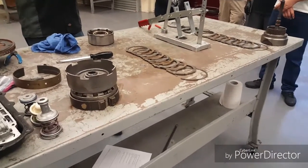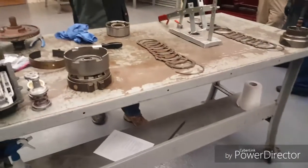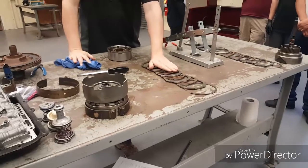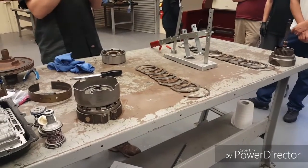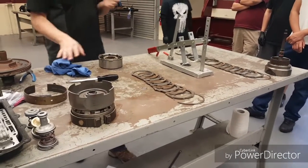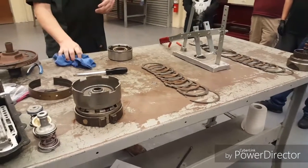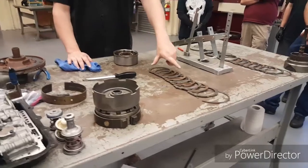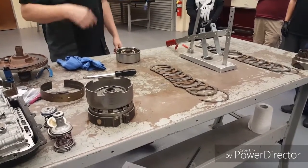In the grooves and out. So this one — smooth engagement. It's first gear, right? When I go from neutral or park to drive, I want a smooth engagement. But if I'm going into third gear, I don't want it to take forever. I don't want two and a half seconds to go by because then it's going to feel like the clutch is slipping. So you'll see some variations in the clutches like that. When you start putting in different, more high-performance clutches, a lot of times you'll see different designs cutting grooves so they'll get through the fluid and engage quicker.